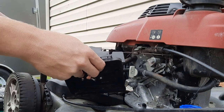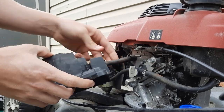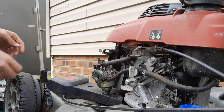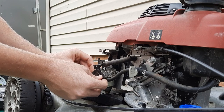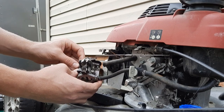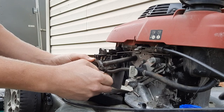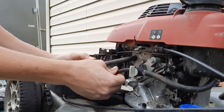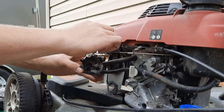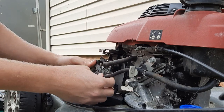On the back side of this plastic shroud for the air filter, there's going to be a vacuum hose that just pops right out. Be sure to lay everything out on the table to make sure you don't lose any pieces. So this was originally right here - when you take that off you have the seal and everything on the back side. At this point you should probably take a photo of all that. Keep track of these small springs. I'll also have to disconnect this fuel line here - I'll grab my pliers.